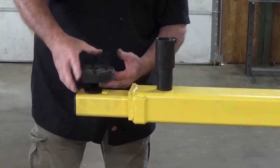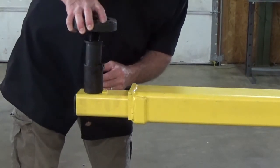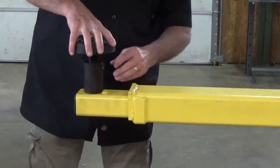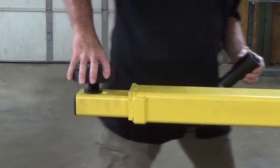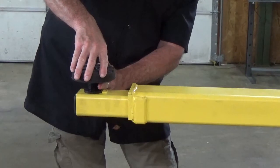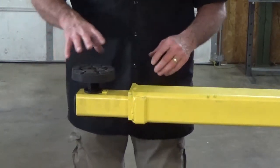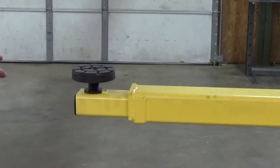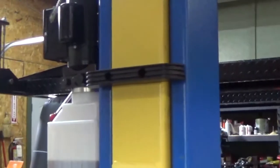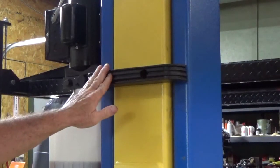The lift pads have a little flat spot which acts as a stop so when you put that in, this will turn without that turning. If you need more height, you'll drop in the extension and adjust for your height - you'll use that mostly for taller vehicles. For regular cars you're just going to use the base pad. I'll use my fingers as a gauge and screw this one up for about two or three fingers, the same for the opposite one. Also on this new style lift you have a bump guard for your door - on the old one it would hit the lift, but now it'll hit this rubber guard and keep both the door and lift from getting beat up.